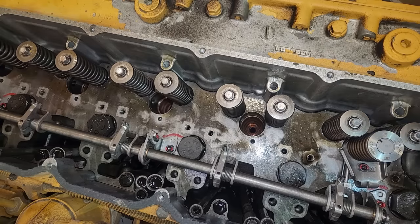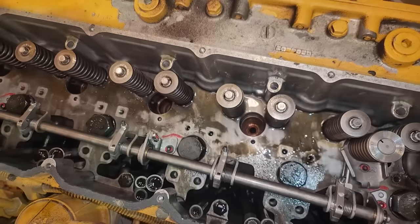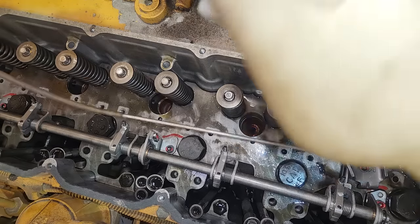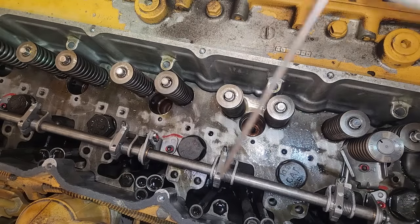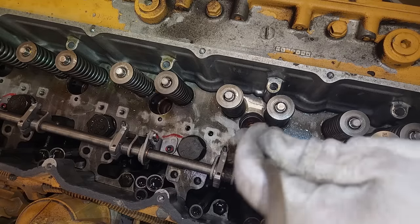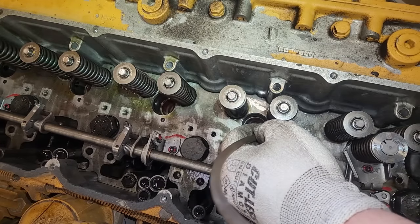So we have reamed it. We are ready for injector installation now. And what I was doing there is just rinsing off any excess grease, and there might be some small shavings of copper, but fortunately, like I said, copper is not magnetic, so if it is in there, there's not much you can do. Best you can do is flush it into the cylinder and then use some sort of vacuum, which I'm using here. This is my little brake bleeder that I use for cleaning out cylinders and various other things like vacuum priming fuel systems.